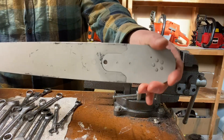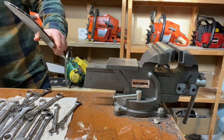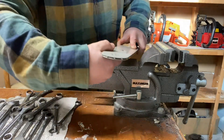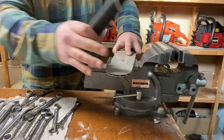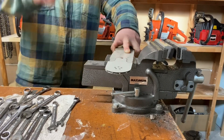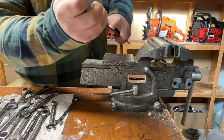It just slides back into the slot. You've got that hole there, you put a new rivet in it. The bar tip I bought comes with two extra rivets. You want something solid like a piece of steel - the backside of my vice works as an anvil. If you had an anvil, that would be great. Put it down flat, and I'm using the wrong tool for the job, but it's going to do the trick - it's a carpenter's hammer. Really, you'd want a big ball-peen hammer. Just hammer it flat right on the rivet.